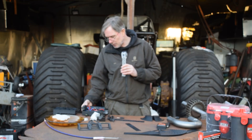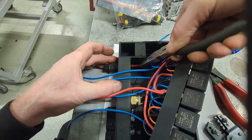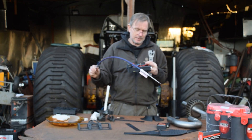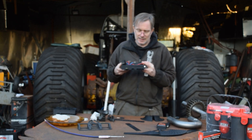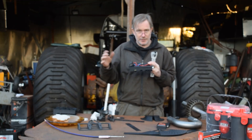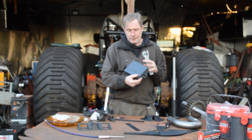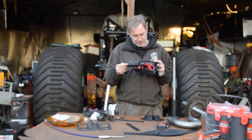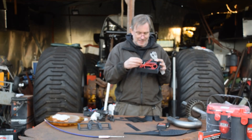I also made a box for my rear steer. It has spaces for 7 relays and 2 switches, and you put a wire into it. This is sitting on the steering hub on the rear axle, so it's a self-centering steer box — you flick the switch and it goes one way, you release and it goes back to the middle. I also made a fuse box for this truck. It has 12 fuses and also 7 relays, and all the pins are click-in pins so they actually stay in the 3D print.